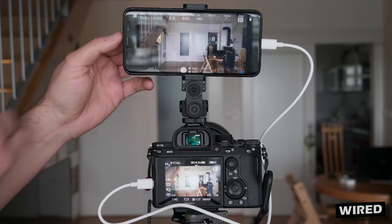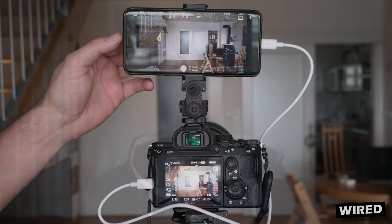You can also check the auto connect checkbox, which means that when you power up your camera the smartphone will immediately run the app and you'll be in monitor mode. It should be that easy, but if you do have problems, chances are that for a wired connection your smartphone doesn't support OTG technology, or your camera is not supported for a wireless connection with the Monitor Plus app. In both cases, either change the phone or change the camera in order to get this running.